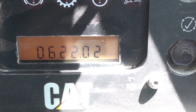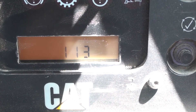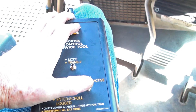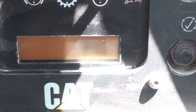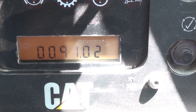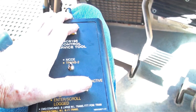The 622 code also shows the same issue with the upshift switch in the transmission. The 623 code shows the same again in the transmission directional switch. The 722 code indicates an above normal voltage in the secondary brake solenoid. The 91.02 code indicates that data is erratic in the throttle position sensor. The monitor panel will show 'end' after the last logged code.